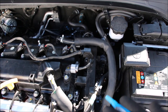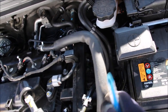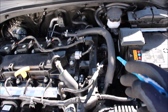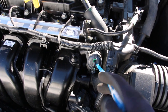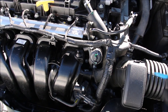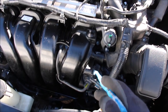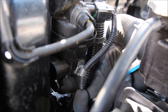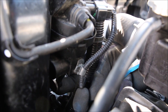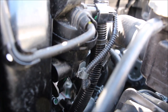Now that doesn't mean this engine is not technically advanced. Underneath the PCV hose we have an EGR system that will recirculate exhaust gases from the back into the intake to be reburned. At the front we have the variable charge solenoid which is responsible for creating turbulent flow as the air enters the engine for better air-fuel mixing. And at the bottom we have the variable intake solenoid, which activates a lever underneath to move the flaps inside the intake plenum to shorten the intake runner length.